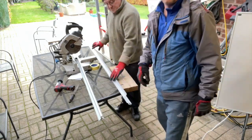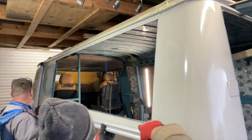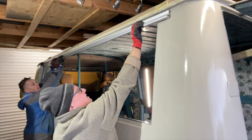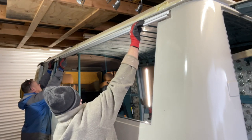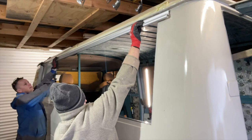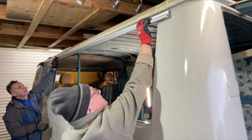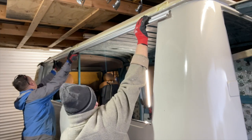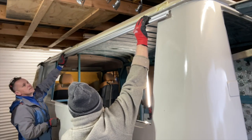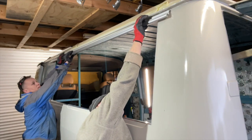That's got rid of that. We'll just get the file on it again, just square it up a little bit. The problem is this isn't straight - the van side isn't level. It's had a new panel replaced at some point in its life. The seam that was straight down the middle is sitting away - it's sticking out either end. I'm trying to work out which end we can pack out. Both ends are going to need packing out. If I just riveted this straight to the side of the van, you won't be able to slide the other part of the hinge in and open the door - it's got to be dead straight.